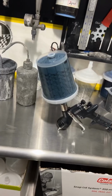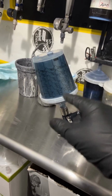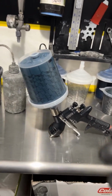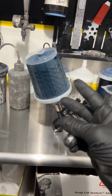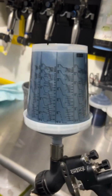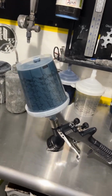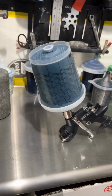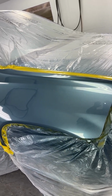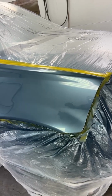Whoops. You know what? That overpour of paint here, it worked out perfectly. I got my coverage coat, my orientation coat, and I looked at it, did my spray out, and it needed not 1 but 2 drop coats. Now it gave me just enough. There's not a lot of paint, like half of an ounce of paint left in there, period. So the overpour worked out in the end, which is great. Number 2 of blending, but taking a small L at the beginning so that later on the color is perfect.